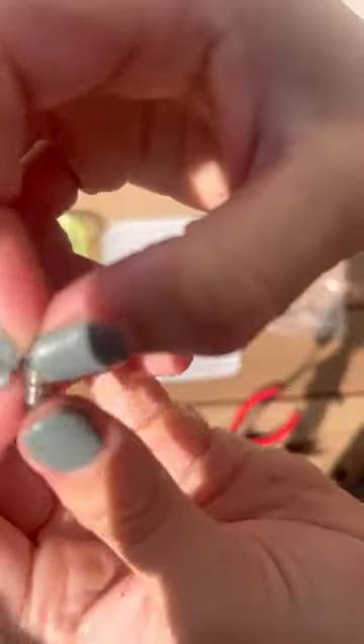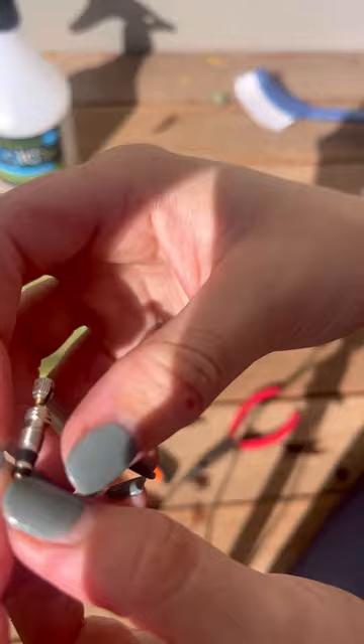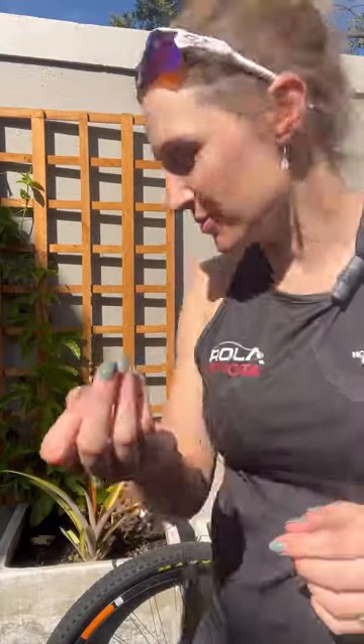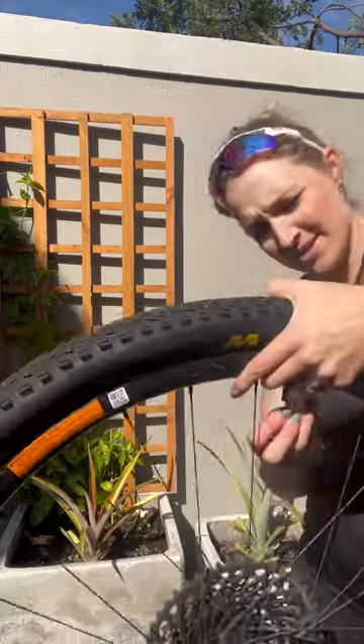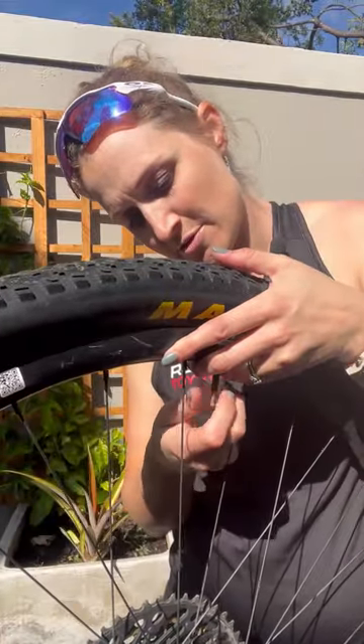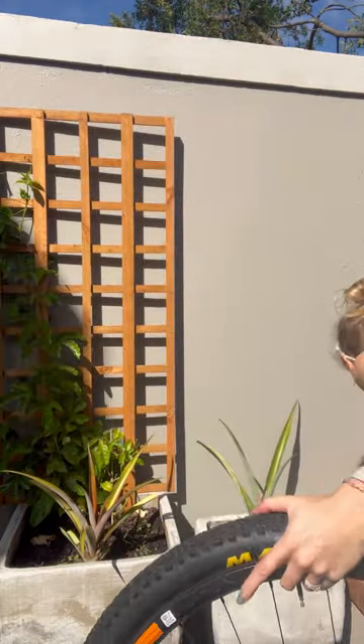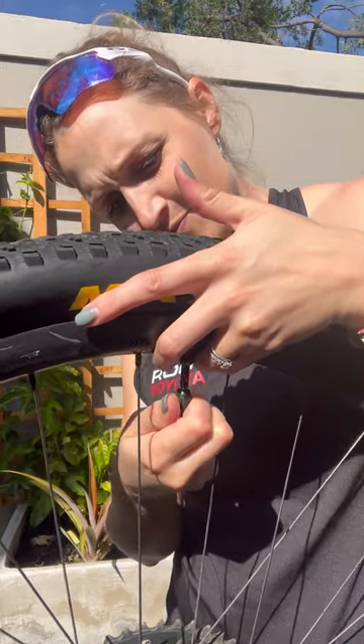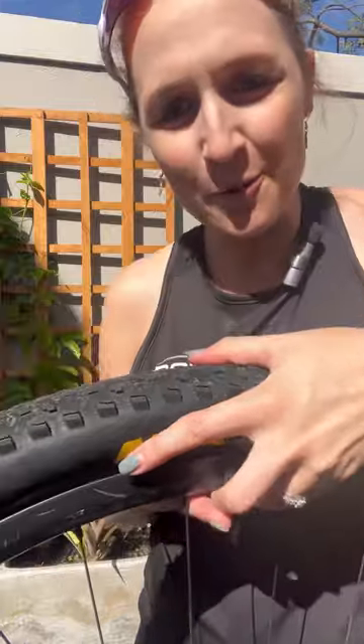For the towel — easy, beautiful. Clean your valve core nice and good. The final thing to do: just pop the valve core back into your cleaned valve, and remember to tighten it with your valve core remover. Ready for another block of training! And there you have it — super easy to do if you're in a pinch and you don't have fresh valve cores, you can always clean them. Hope you have a fantastic week and we'll check you on the next one. Cheers!